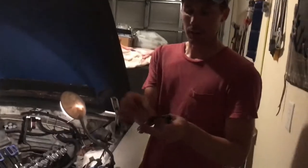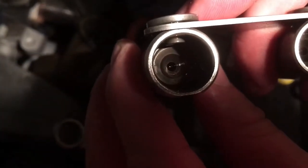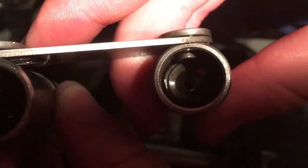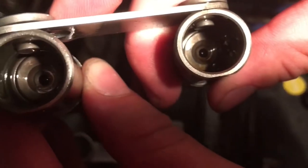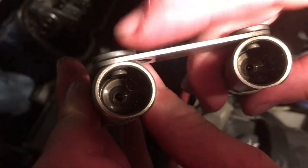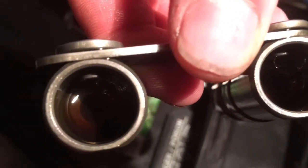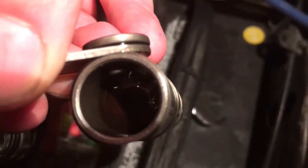I took the first set of lifters out and I was looking real hard at everything. I noticed that this ball here was poking out just a tiny bit more than this other one. I was talking to my father and he said while you've got it apart, go ahead and check another lifter. This is how I took the noisy lifter out — it looked just like this, with just a small amount of residual oil in it. Now I'll show you the other lifter — look at all this oil that's in there. So I think it's kind of cut and dry: that pair of lifters was not passing oil up through the pushrods to get to the rockers, especially that far lifter for whatever reason.